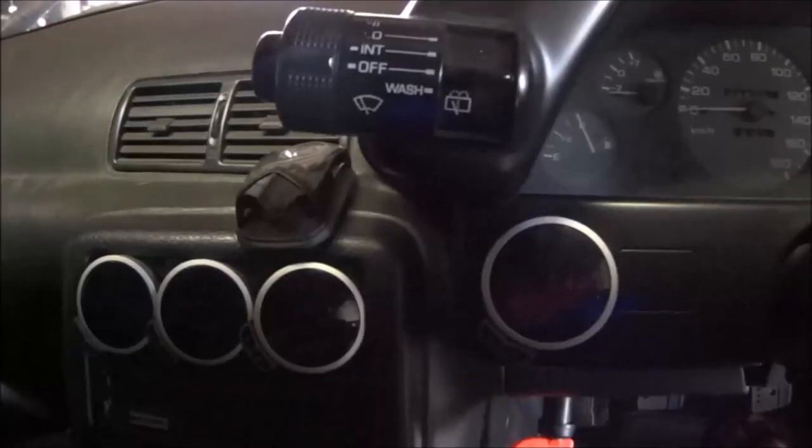See how much meat there is on the pad. The pad's probably ancient, and it's probably a terrible brake medium to begin with, but I think it's more of a mechanical thing of the caliper not closing up. So, let's have a look.